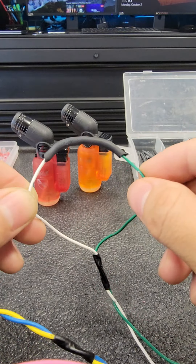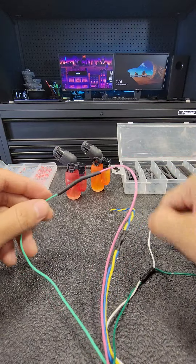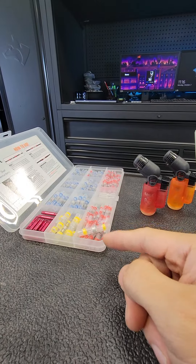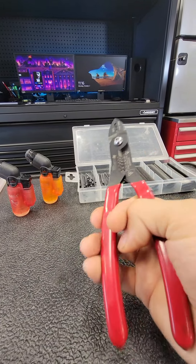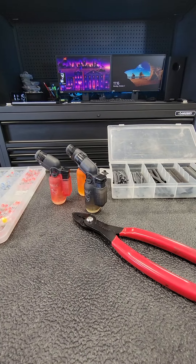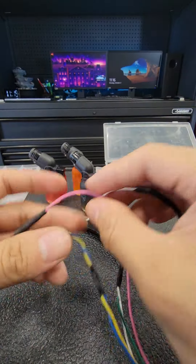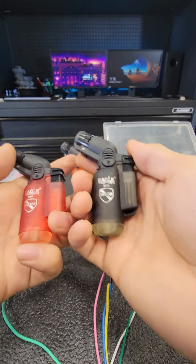Bam, just like that — that's how I do my wire repairs. In my opinion, that's how you do a proper wire repair. Get yourself one of these torch kits, really cheap, the solder seals are really cheap as well, and some heat shrink. I'll put all the tools I've used in the description. You have yourself a good one — that's how you do a wire repair the correct way. This one came out a little better, as you can see.